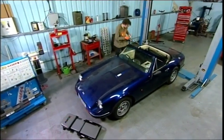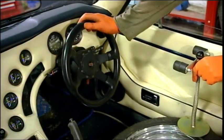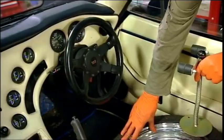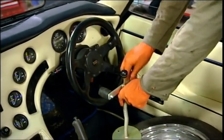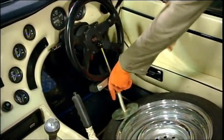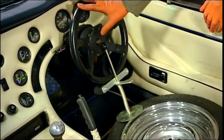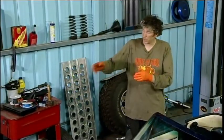The first thing I have to do is sort out the steering. I've got this nifty little gizmo here — what's going to happen is I'm just going to pop that into the cab, straighten up the steering wheel, and then because we haven't got a seat I'll put a wheel in there just to give me somewhere to push against, then pop that down into position. That will hold the steering in exactly the right position while we do all the adjustments.